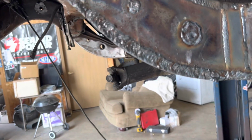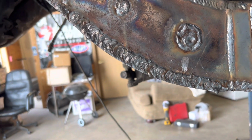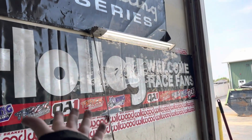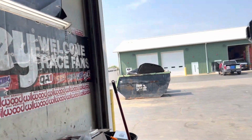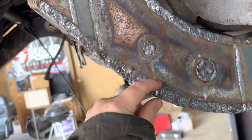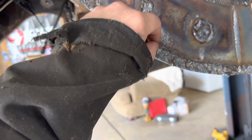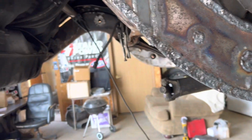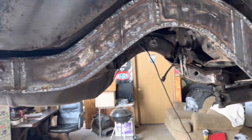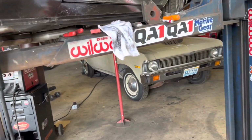You'll get some stuff that'll roll out and be kind of hollow, when the wind takes the gas away. Right now today it's windy. As you can see, well, it was just moving, damn it. But the wind will blow your gas away, and then it'll bubble up and act like there's no gas. So you guys out there, if you're trying to weld stuff and it's hot, and you got a fan by you and you can't figure out why it's not welding that good, well, that's why, because the fan is blowing the gas away.